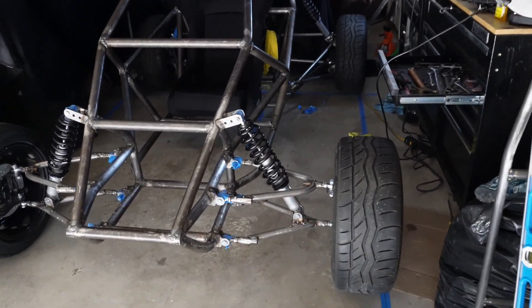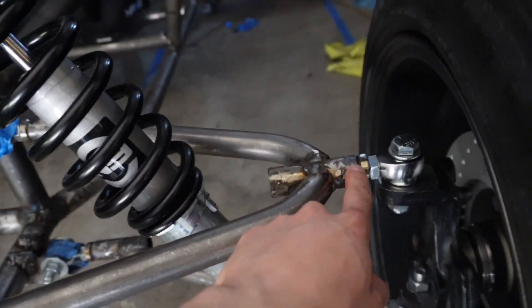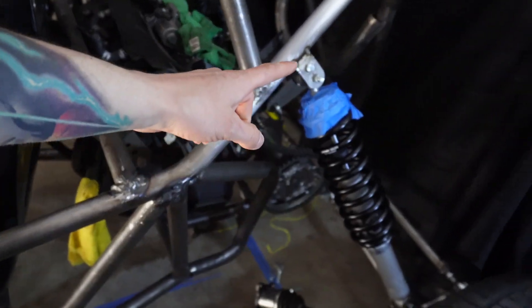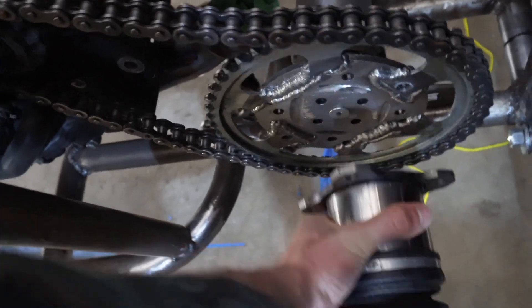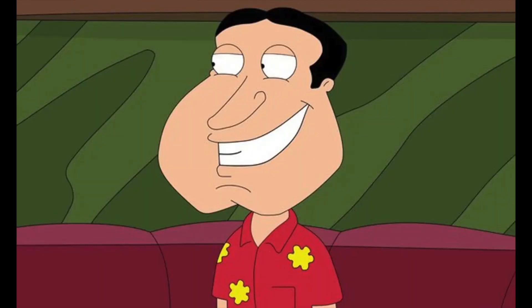The problems I'm running into are that the rear wheel and the front wheel are not in line yet — the front end is still too wide and I have to bring them in about another inch, which I'm going to do by shrinking this back and dropping this back on both of them. I got the rear end done and it looks sick with the slanted shocks, but I still need to figure out these CV axles because they do not reach — they're so far off. Even with the plunge, I'm still like four inches from the thing on both sides. CV axles don't reach, so I'm going to have to redesign this whole drivetrain.